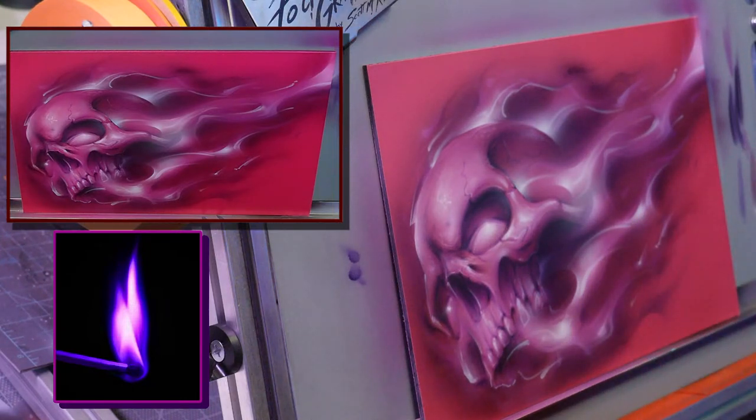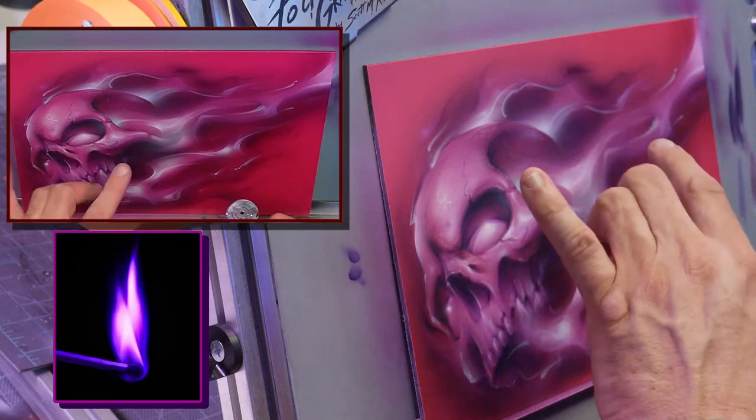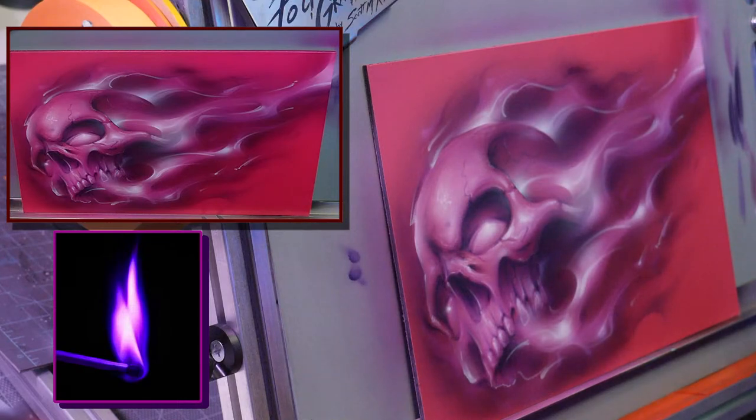Nope, I never sprayed any bleed check. This is the illustration opaque white, and I've used very little reducer. Actually, I didn't use any reducer in the candies, so I'm really not getting a lot of bleed, especially because of the new mixtures. If I put a lot of reducer in here, then that would probably bleed through. But I don't use the 4040 bleed check sealer.